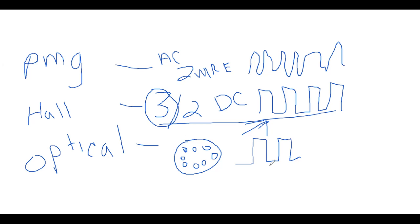You can't tell unless you're looking at the system description or doing a physical inspection of it. And it doesn't really matter, because if we're looking at the signal and it's nice and square and healthy like that, then we don't have to worry about it. It's working fine. If there was a problem, let's say the next pattern coming up did this, and then we had a square, and all of a sudden it did this again, and we had a nice square.